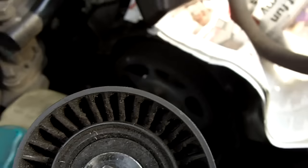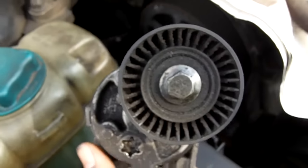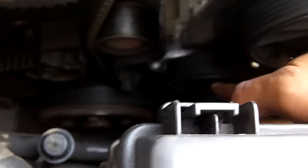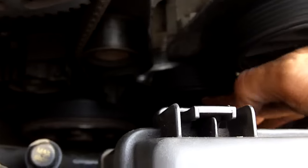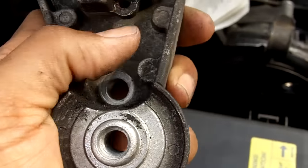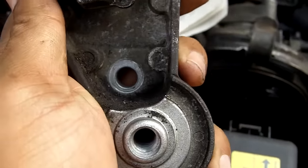To illustrate it better, this is an old tensioner that I removed from the car, and this is what I'm actually going to be taking off. You can actually see it just down here. If I touch there, that's the tensioner roller just there. Then the idler roller is tucked away underneath. On this, the idler is missing, and the reason for that is, A, it means that you can get the tensioner out of this very tight gap without having to remove anything else.